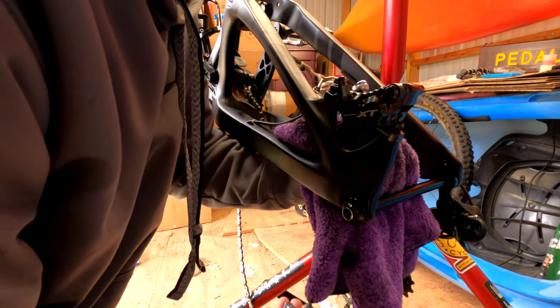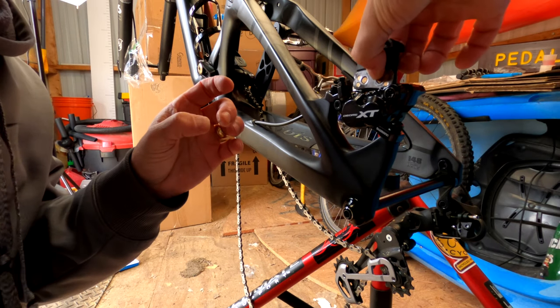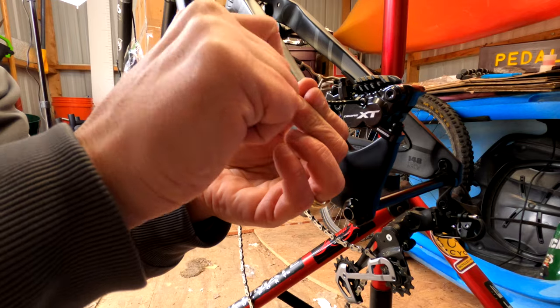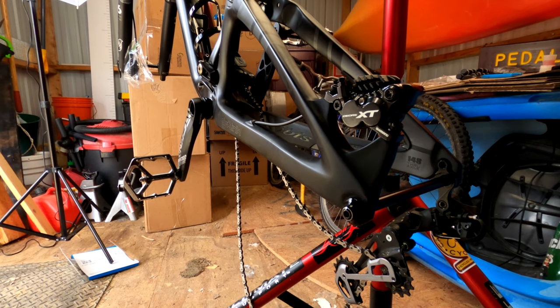Brakes should be ready for a good long part of the season now. Put the pads back in — they slide right in. The little beady clip goes back over. Reinstall your wheels and test thoroughly. That was the install of the brake hose. It's super simple, and as you can see I did it in a very cramped spot — so if I can do it, you can do it. I encourage you to give it a shot. If you've enjoyed the channel and found it valuable, please consider subscribing, give it a thumbs up, hit the bell notification so you see when I upload a new video. Leave me a comment of what you think below. Get out and ride every chance you get!